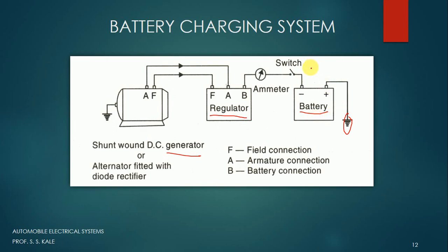When we make the switch on, the generator takes mechanical energy from the engine and gives electrical energy as output. This electrical energy is given to the regulator, which regulates it so the output value is constant. This constant output goes to the battery and the battery gets charged continuously. Once it gets fully charged, there are automatic switches that turn off the charging and extra charging of the battery gets avoided. Next time when it gets discharged, we can make this switch on again and electricity will once again be given to the system.